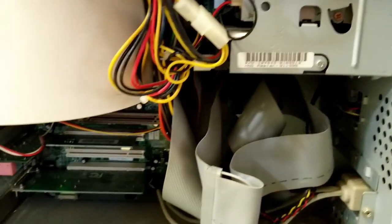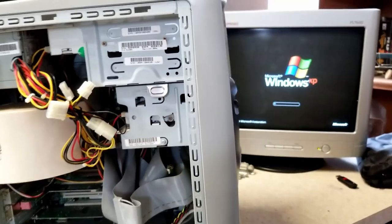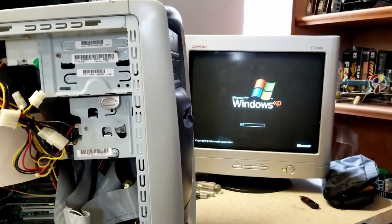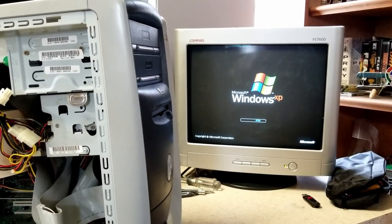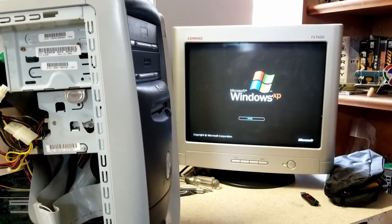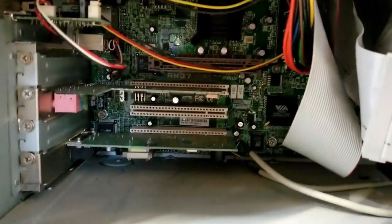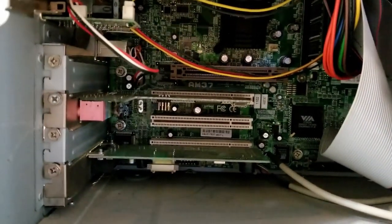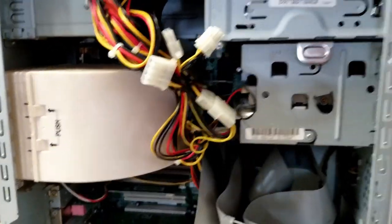It's got Windows XP still installed on it, so that's a good sign. Nothing seems to be smoking, so that's actually really good news. Looking inside, there's an OEM sound card and modem, but there's also an empty AGP slot. I'll have to find a decent AGP card to pop in there, and we'll see what we've got for a CPU in here.